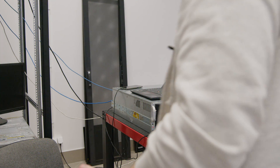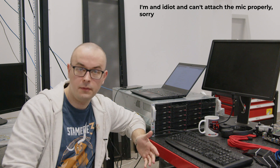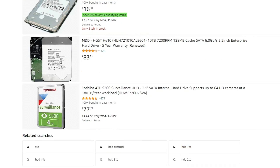I've inserted some drives, and you're probably thinking about ZFS, BTRFS, or software RAID — but no. I wanted to try something different. Ceph represents a software-defined approach to distributed storage systems. With Ceph, you don't need hardware RAID cards or any specialist equipment, and you don't even need matching hard drive types and sizes. You just grab anything you have on hand and configure a cluster. What's even more interesting, with Ceph you can expose your storage in any way you'd like — as a file system via NFS, as a block device, or even as an S3 object gateway.